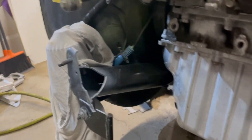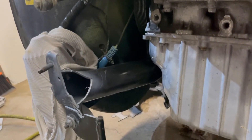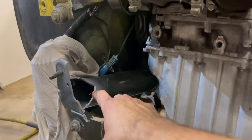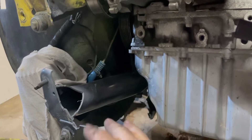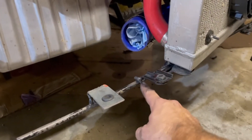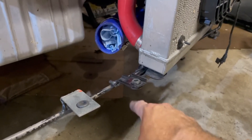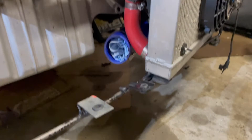For the meantime I've got everything taken back apart, threw some primer on a couple spots and going to lay some yellow paint on it. I decided for now I'm going to leave this section open because it's actually easier to get the bolts in and out. For this next car show I'll just leave it like this, and when I tear it back apart to do the smaller pulley I'll box it in. Next order of business — I had this bracket spot-welded on, but I'm going to cut it off and move it back just a tiny bit because the intercooler was sitting a little too far out on this side.